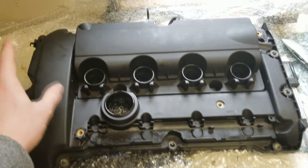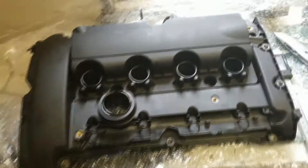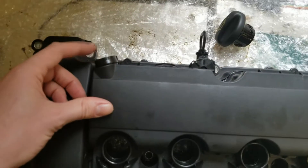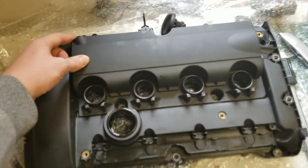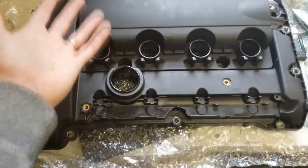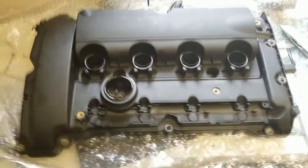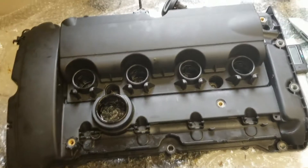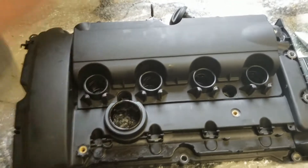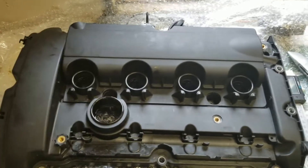I'll do a quick rundown on what the problem was, because I found out what it is. Basically, there's a hose in the car that connects to the intake manifold and sucks air — that's the positive crankcase ventilation that sucks air from underneath the valve cover. That's important because not only does it remove vapours from the engine, but it's also very important to have a negative pressure, a vacuum, on that side of the valves, because it helps to seal them.